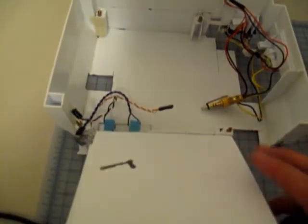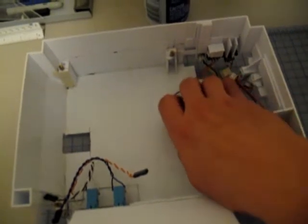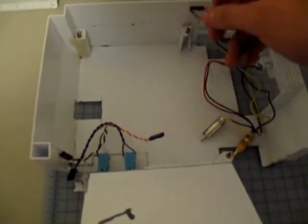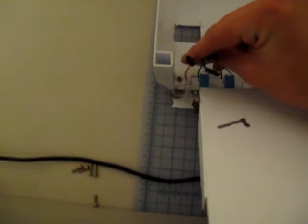Here we have a tray. The motherboard will mount upside down in here. Here's a headphone jack and the video jack. And back here there's a little power jumper right here. And the channel 3-4 switch now has a jumper that goes to the DVD drive, so that will eject the DVD. You can see the power reset and the power LED are all here.